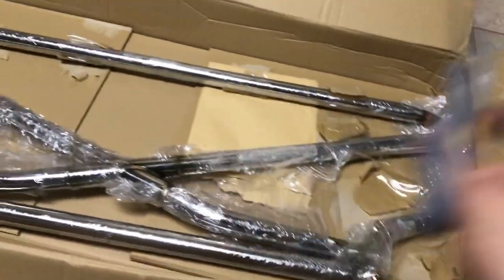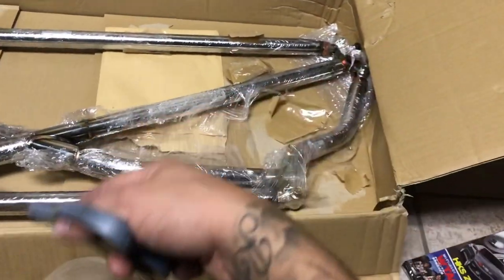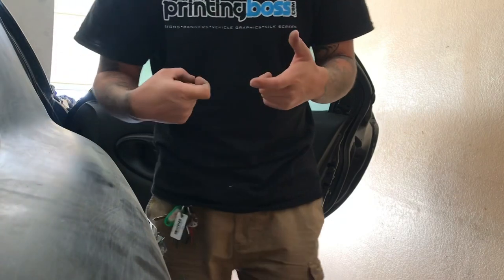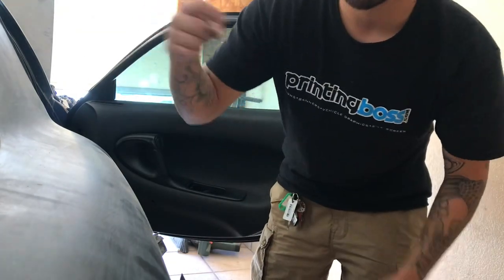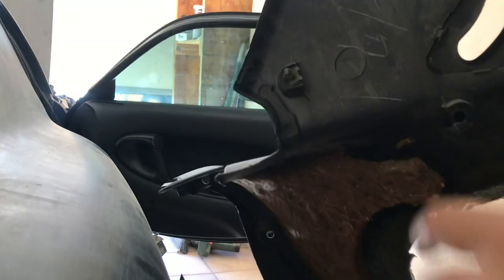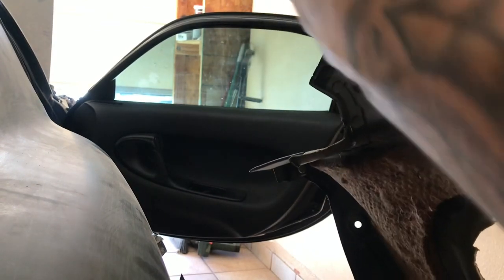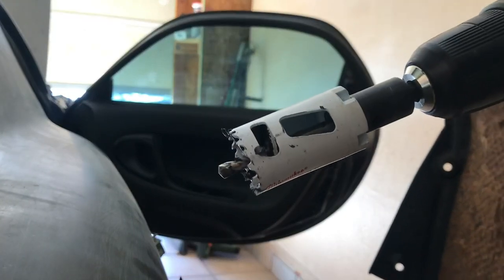It's hard to do with one hand so I'm going to open it up and start mounting this thing. By the way it looks, I'm going to have to take the bar apart and install it one bar at a time. What I need to do now is remove this rear quarter panel and drill through it. I already did the other side so I know where to drill — it has markings in the back. I need to drill right at this corner, right above this line, because that's where the hole for the bolt will go. I have about an inch and a quarter hole saw here that I'm going to use.